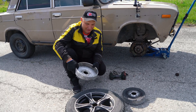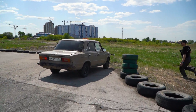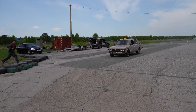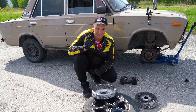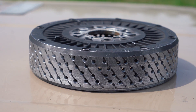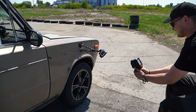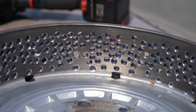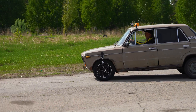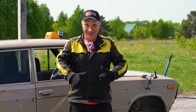Let's do a recap. On the stock drums I had to use up the entire lot from the 80 kilometer an hour entry point. After the first round of drilling, honestly, that made the brakes much more effective — you saw the decrease in stopping distance, it was about three or four meters, you could really feel that the car's braking had become much better. When we drilled even more holes, the first time nothing really changed aside from having to press the pedal with quite a bit more force. When we added even more holes, that's when things began to deteriorate — I was pushing down even harder, though the car was decelerating and ultimately came to a stop. Okay, you requested we try this and we did. We all saw how it worked out — you be the judges. That's all I got for you — watch, subscribe, send in your suggestions, comment, give us a big thumbs up. Catch you later.